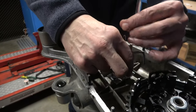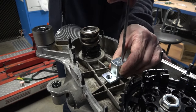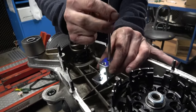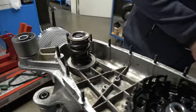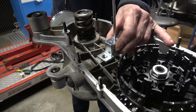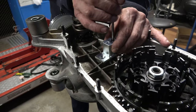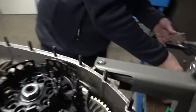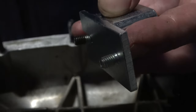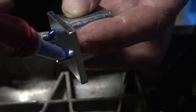The lower one has already gripped — yes, it does block, so we need the shorter one in this case because it still has some play. We take the shorter one, confirm it can be tightened properly, then add a bit of Loctite. Both allen screws are in — a bit generous with the Loctite, but both are secured.